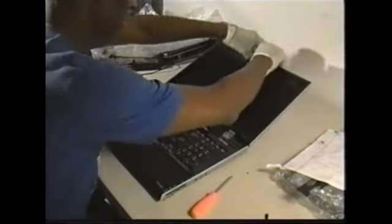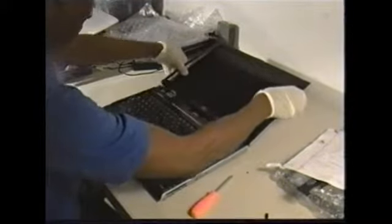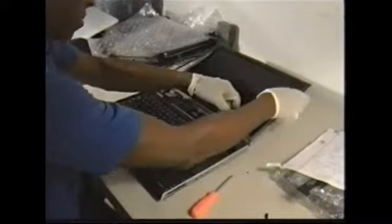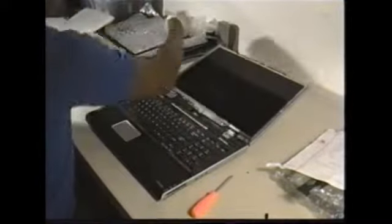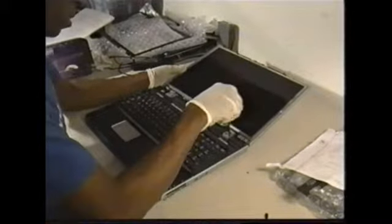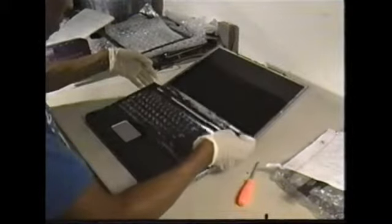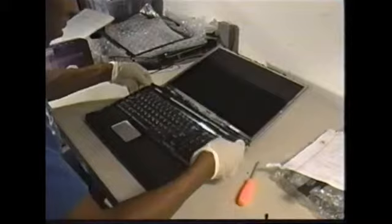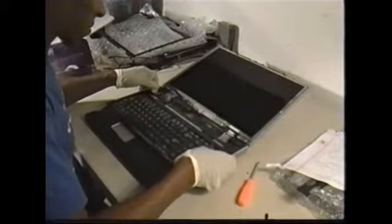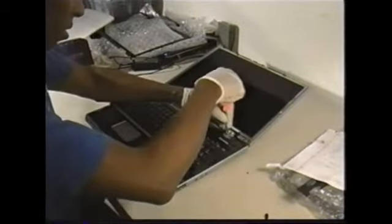I think the snap is up like this here. There are some screws here. On this laptop you've got to move the keyboard forward. There's a screw that goes on the bottom — I already have that out. The keyboard has to slide forward to get to the main hinge right here.